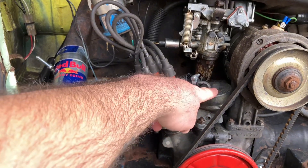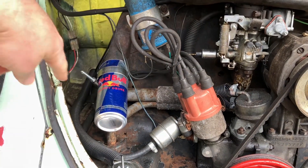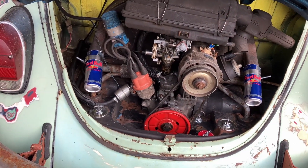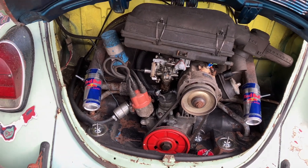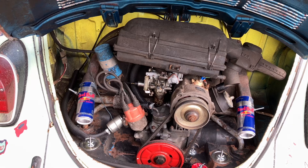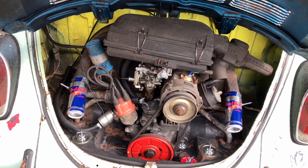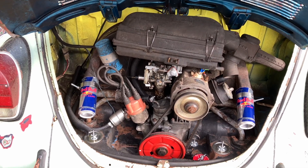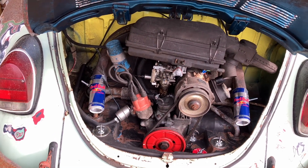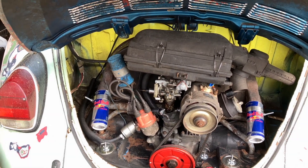What I'm going to do is delete this fuel pump. I bought a cap that goes over this connection here and bolts down. I'm going to rerun the fuel lines and throw an electrical fuel pump up near the gas tank, and put a fuel pressure regulator in here with a gauge on it to make sure I'm able to dial it down to about 2.5 to 2.6 psi — I'll verify that before I do it. I'm also going to put a switch on it so I can turn it on and off from inside the car in case there's some issue where it's pushing fuel and I don't want it to. I've got all the parts ordered — should be here somewhere between two days and six days.